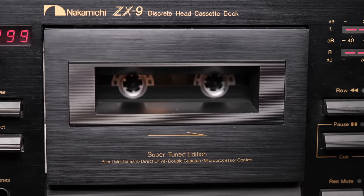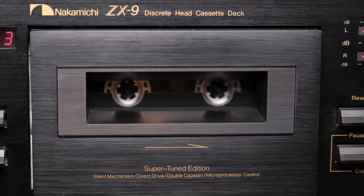What do I like about the sonics? It's a detailed, big sound — typical of Nakamichi. In some forums they say the lower register is not that precise or punchy, or not that deep — more precise but not that deep. I don't hear this at all. I sent the deck three times to a lab; I have a flat frequency response all the way up to 22 kHz, actually beyond the specifications. Everything is perfectly calibrated and I can rely on its performance. I think it has an incredible bass. I love the sweet mid-register — fantastic for voices. And the most difficult of all for tape, the high frequencies — the cymbals, the crashes — are just perfectly reproduced.